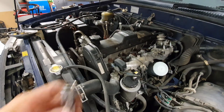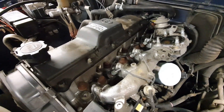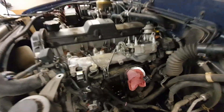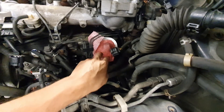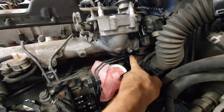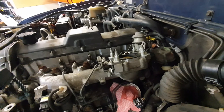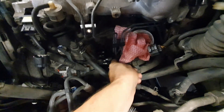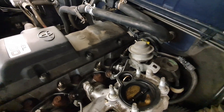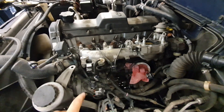Having some of these tools - they weren't expensive, so it's a tool for life. I've just sprayed a bit of WD-40 on all these just to make sure they crack quite nicely. I've pulled out my oil filter just to give a bit more room and put a rag in the opening to stop any debris falling inside. I was able to get up to the far corner nut up there and all the rest of them cracked, so hopefully it's as easy as pulling it off.